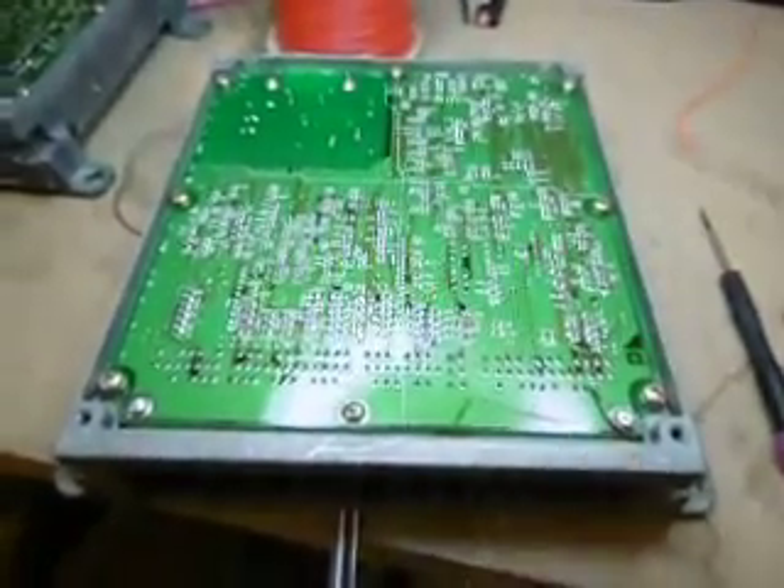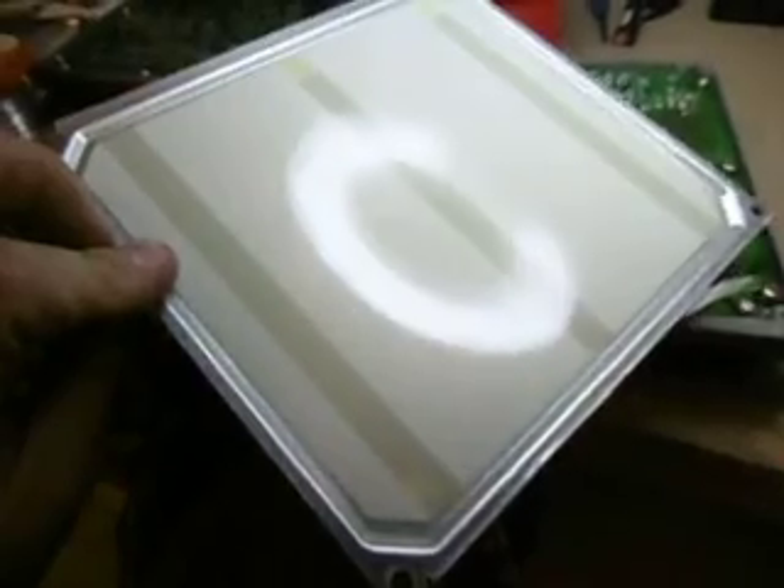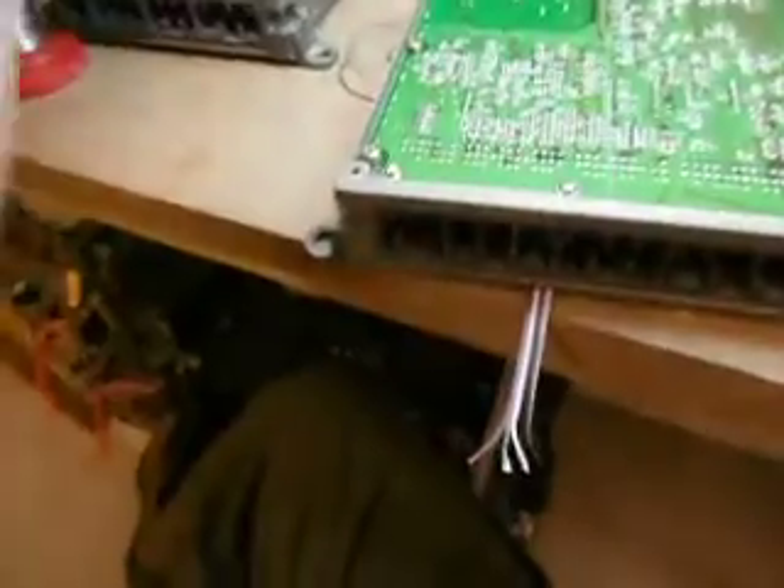Once you've connected the SCS wire, you can put the cover back on the MCM. Make sure that you put the insulated cover — this is the cover with the plastic inside — on the top of the MCM. You can put this back into position now, as you don't need any further access to that side. Screw that back on.